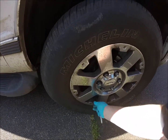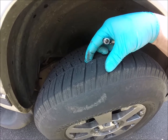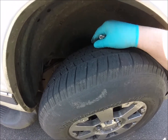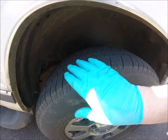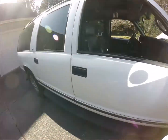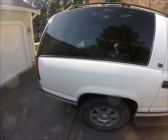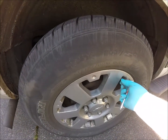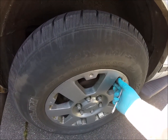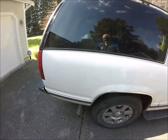We've got about 35 psi in the first tire, which is good. We also want to take a quick look at the tread. There are wear indicators called wear bars built into the tread — when you can see them across the tread, the tire is worn out. You're also looking for any cupping or bald spots on the inside or outside. Moving along, we're checking the outside of the vehicle for obvious damage and checking all four tires. The next tire is also a little over 35 psi; tread looks good all the way across.